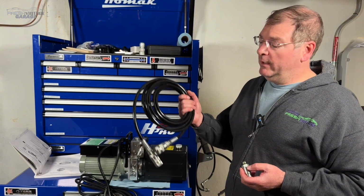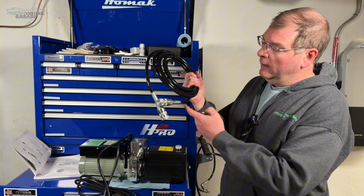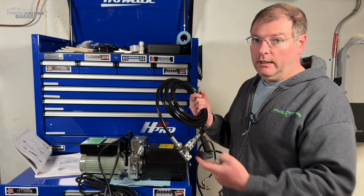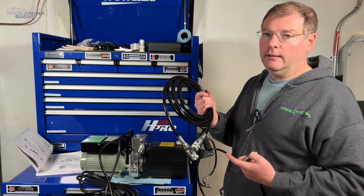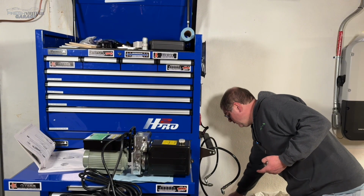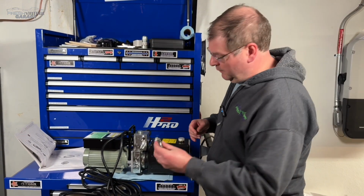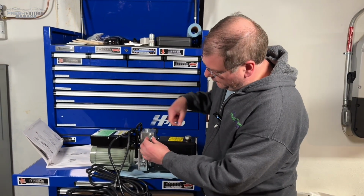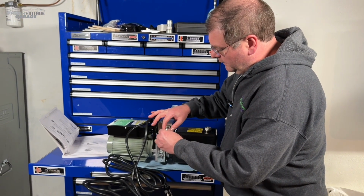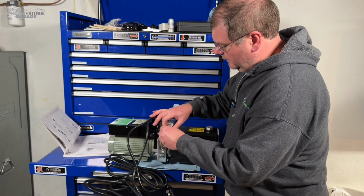So real quick, we just wanted to mention we do have the ends on the actual hoses. The manual does state you should make 2 to 3 complete turns on these to actually get these tight enough. So just keep that in mind. You might need a vise or something, but we just wanted to show you there's 2 more fittings here. We're putting the last one in. There's little red caps in here, but these have O-rings on them. So you just want to not cross thread that.